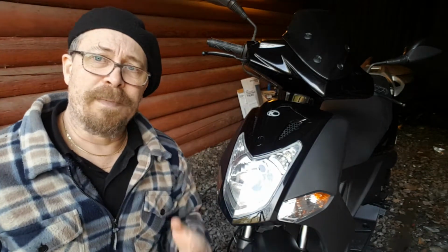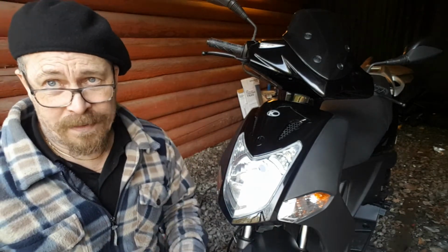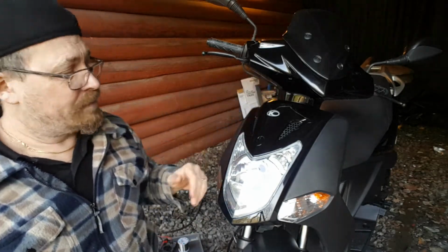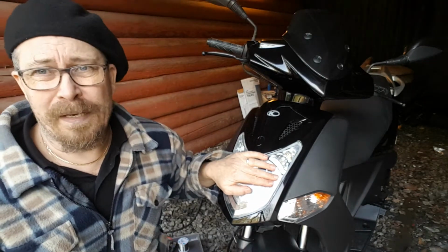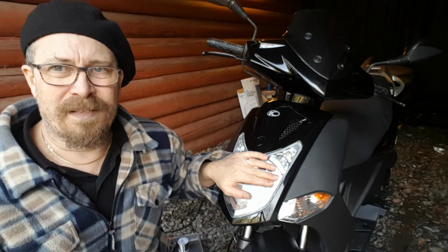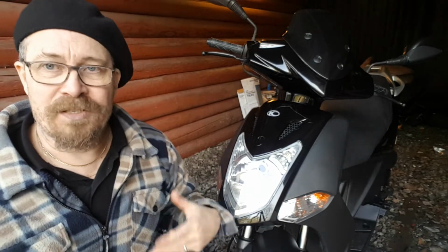So I'm going to use the right switch. When I start the moped and then pull the right handle once, it will start the low beam. I have a switch on the other side, high beam, low beam, but nevertheless, when I start this moped and it's a bad battery, it's not beneficial to have the low beam on because it's 35 watts, it's like 3 amps, and it's a 12 amp battery, twice the size of the original one. But starting the moped with a pretty bad battery will actually be hard. It's something with this moped or in the electronics, the ignition coil or something.